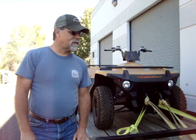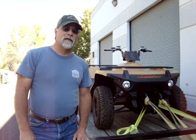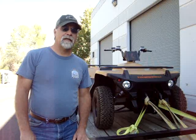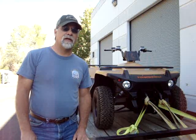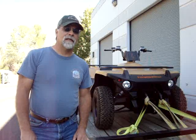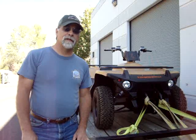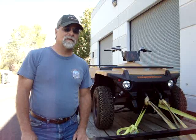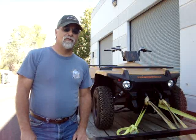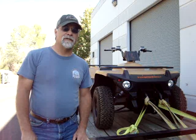The reason that we're working on this vehicle is that it doesn't have an auxiliary battery. It has a DC to DC converter, and it basically had been left unattended and completely drained the pack. It's normally an 80-volt pack — it currently measures 10.7 volts. Anyway, we went and picked this up last night after hours. It was dark, I was hungry and tired, so we just stuck it in a bay overnight. Now we're going to unload it off the trailer and take the covers off and see what we have.